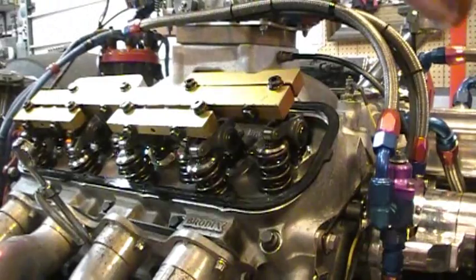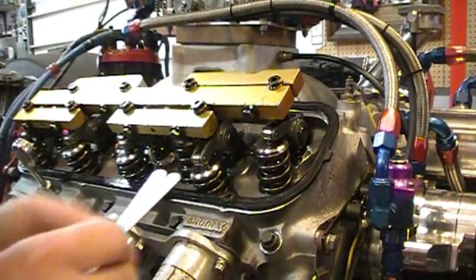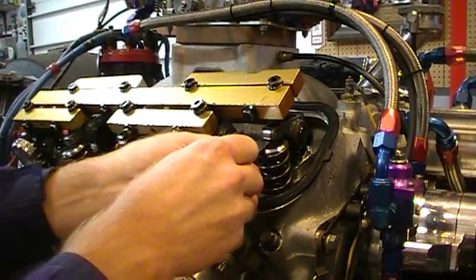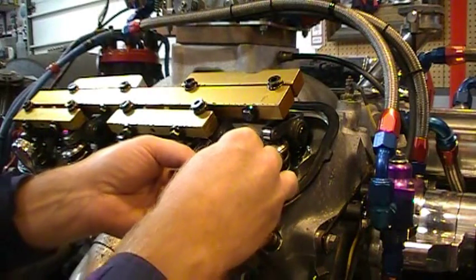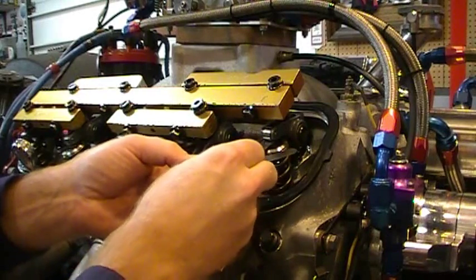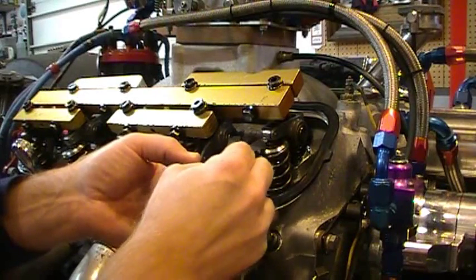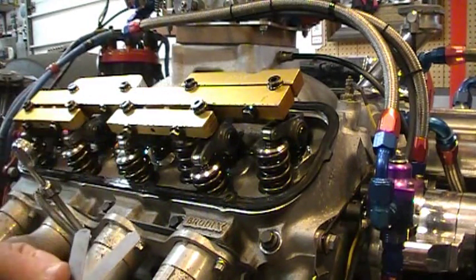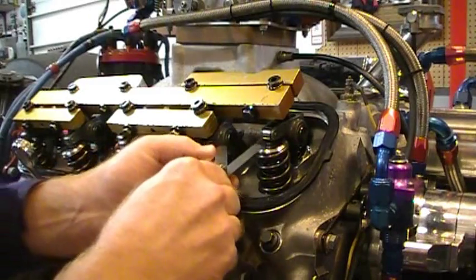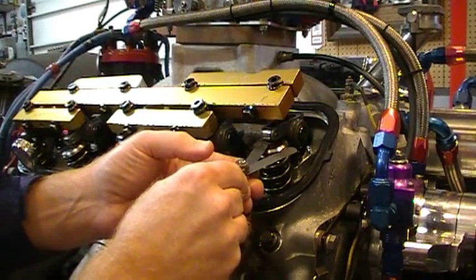I haven't checked this for about a month, let's see where we're at. My exhaust just started to open, so we're going to check the intake. The .022 is going in — let's put a .024 in there and see where we're at. This one's a little loose: .022 is going in and .024 is going in. So this valve would need a little bit of adjusting — it's just a hair loose. Check your cam card; that'll tell you what gap you should set. I set mine cold at .022, so the .024 going in means this is a little loose.